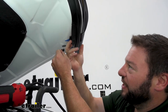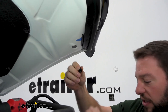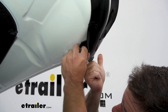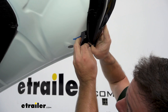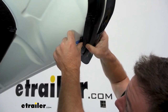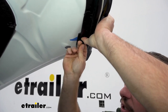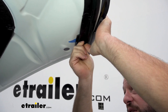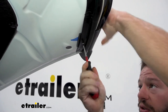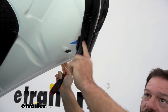Now we're going to put our new fasteners into place. You want to make sure you slide the bug shield underneath the rubber seal here, and then this portion is going to go under there as well, so we're going to line that up with the hole. Make sure it's lined up right there. I'm going to bring the bug shield back a little bit so we get that hole exposed. Push that in — now it's not going to go in very far right here, but we line it up, start the screw just a little bit. Don't go too much because it's going to expand as you do that. Get it started so you can push up with the screwdriver and it should snap into place. Push up with the screwdriver — there you go, it's gone into place and then I can just tighten it down. We're going to repeat that process on all the other holes.